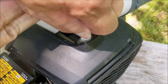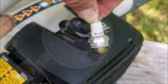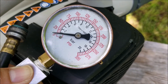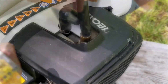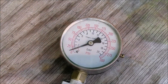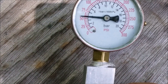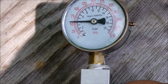You can find these online for a few dollars. Simply remove the spark plug, install the tester, squeeze the throttle and pull the rope a few times. My gauge is a bit off but I want to see a reading over 50 psi — the higher the better. The reading is about 55 psi, which means it's a bit worn down but should still be enough for it to work.